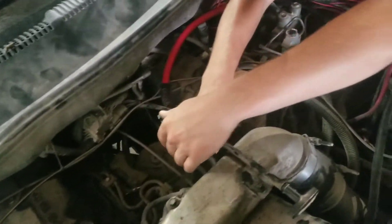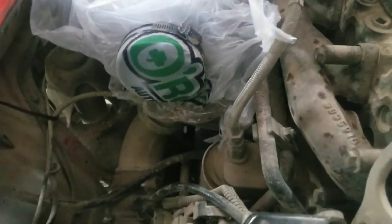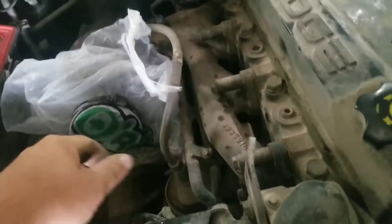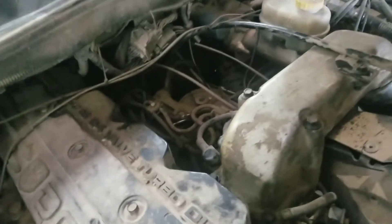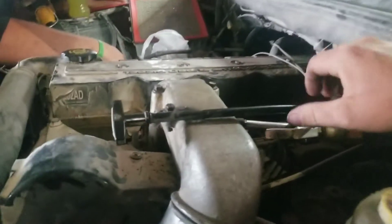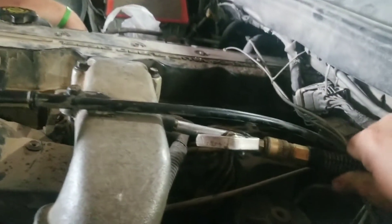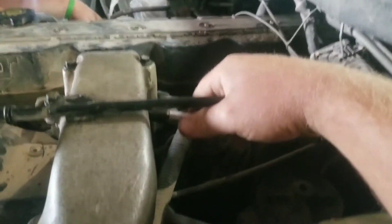Here's what the little port's for in the intake — a rubber-tipped air blower and give her some shop air. You'll notice our little bag is starting to blow out — that's what she's supposed to do, keeps the air inside the engine. Now we're going to have to shut our fans off in here so we can hear it — that's how you find your air leak. With everything off in here and quiet, maybe we can hear where it's coming from. Keep that in there good and tight.